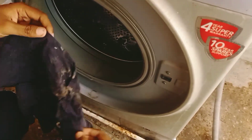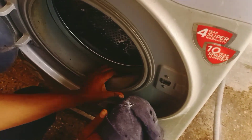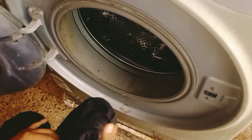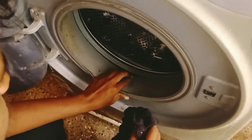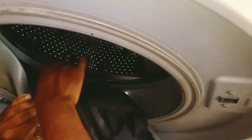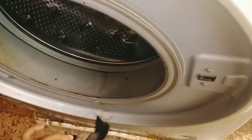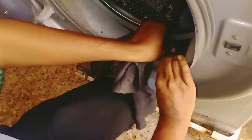Now we have to clean the belt as well. We have to clean the rubber tube gasket. We can open the rubber tube and clean it. When I had not cleaned it for a long time, it got some fungus. Because drum cleaning was not done regularly, it built up. It's a dirty job, but it's not a bad idea to do it.